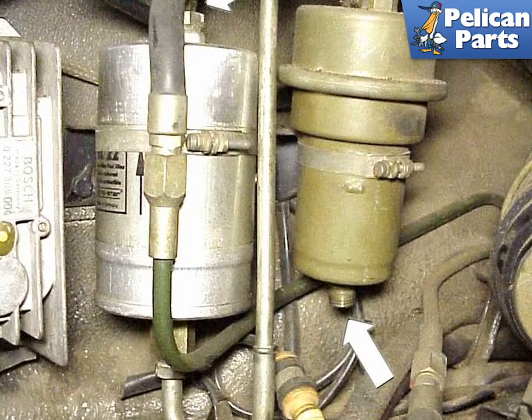All of the fuel lines connected to the engine need to be disconnected. On the 911 SC there are three separate connections — fuel lines should be disconnected at the fuel filter and fuel accumulator if possible (white arrow). Be aware that some fuel will spill out of the lines when you disconnect them, so keep any source of potential flame or shop light away from the area. Prior to disconnecting the fuel lines, you may want to remove a few of the engine compartment's heater hoses — the large one that connects the blower motor to the fan shroud usually gets in the way.